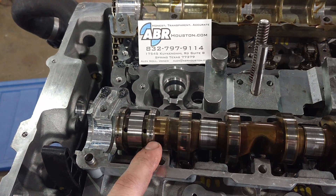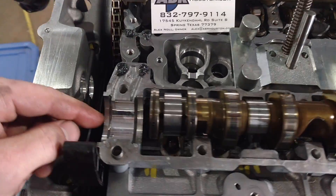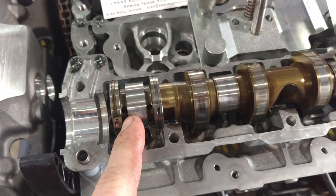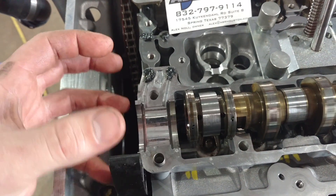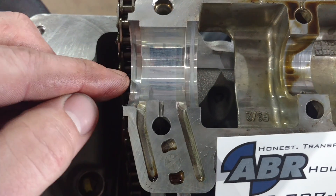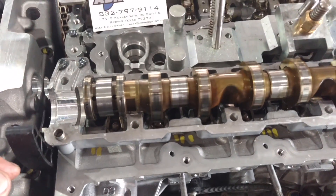These are steel and they came from the factory with steel. What happens is when you have a steel ring riding on these grooves, the oil comes through these passages and they actually physically go inside the camshaft. That goes to an adjustment wheel on the front — that's called vanos in BMW world, or variable valve timing essentially. What happens is they start to get a groove. Here are the old ones and you can see these very heavy grooves that have been worn into what's called a cam tray, which is basically like a big clamshell that holds the camshaft.